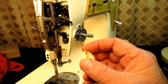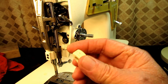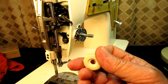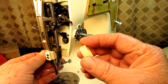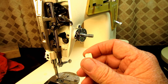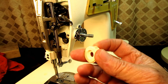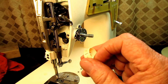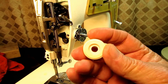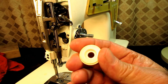My estimation was right — this plastic part has failed, which is pretty common. The slant-needle machines from the 300 through the 500 Rocketeers had all metal parts, and failure is uncommon there, but many Singer models that use plastic fail eventually because the pin presses on that cross member every single time you raise the presser foot. This machine was made around 1970, so it's about 48 years old. Some plastic from that era is more brittle. On this one it is totally missing — it's a clean break. If you didn't know it was supposed to be there, you'd think the part was fine.